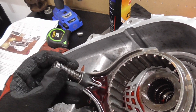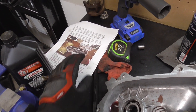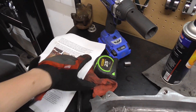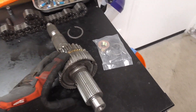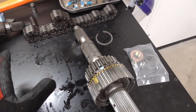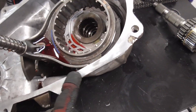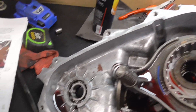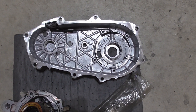I had to trim this down, so I went ahead and did that while the case was split. It was 10.2 inches and it says you've got to cut it down to 9.38. So I did that, got the new shaft on, and I think we're ready to start going back together now. I got the mating surfaces really clean — looks good.